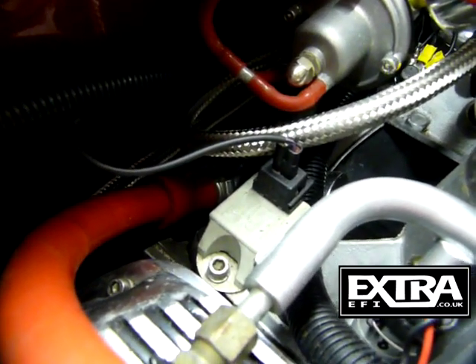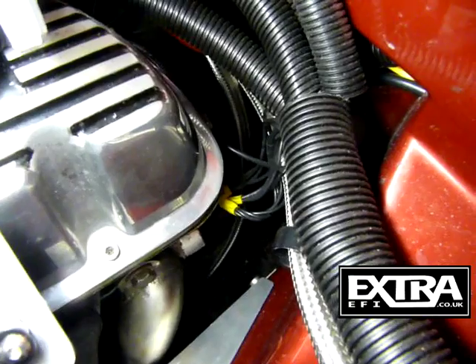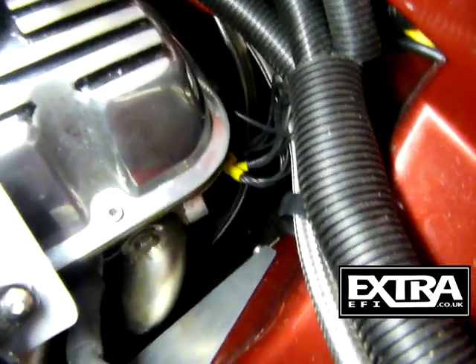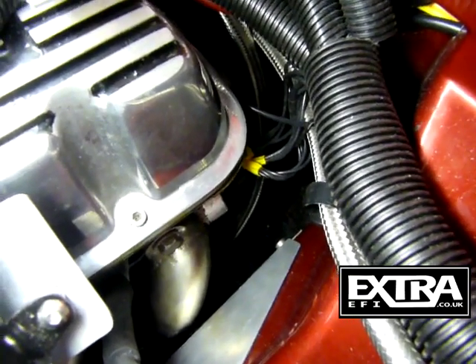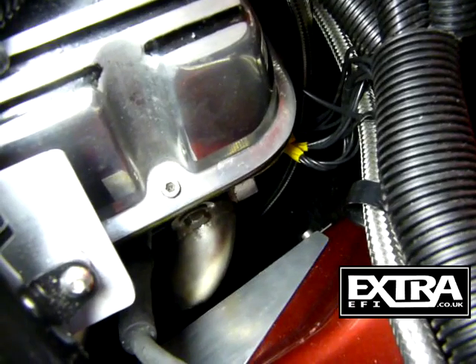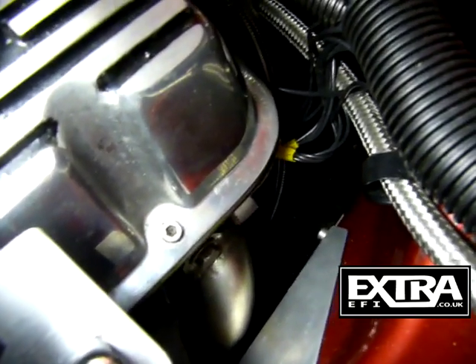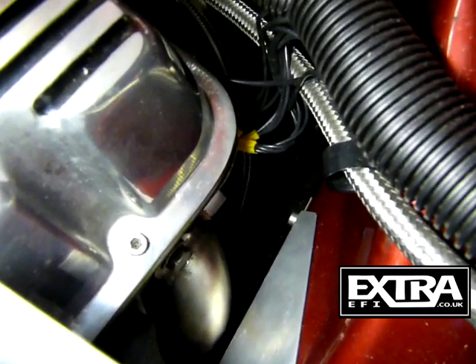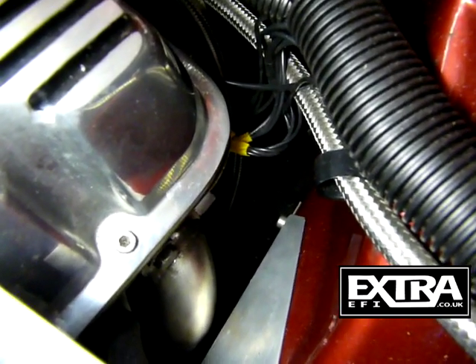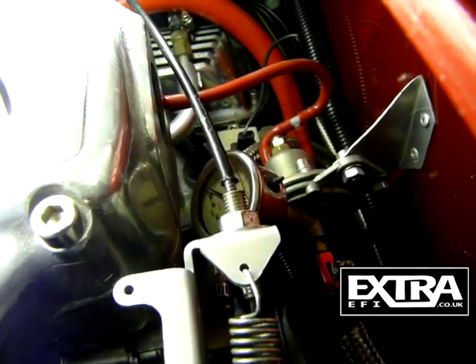There's just one wire coming off the capacitor which goes to the 12-volt feed to the ignition coils. As you can see, all my grounds go back to the same point on the engine block - the same bolt. I've got so many because I'm running COPs and single sequential fuel and sequential ignition on this engine, so I can't get them all on the same lug - I've got about two or three lugs there with all the wires soldered in, all back to the engine block.